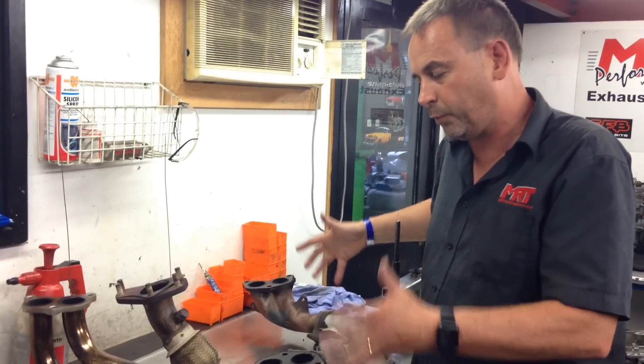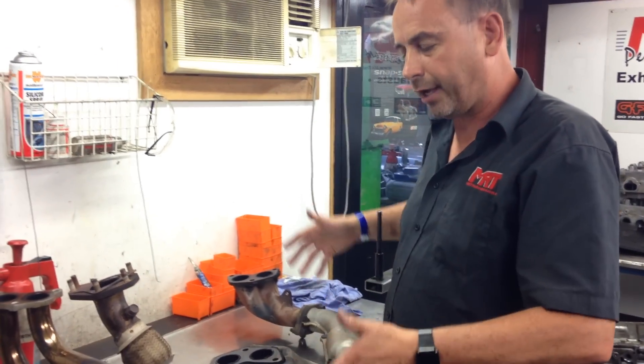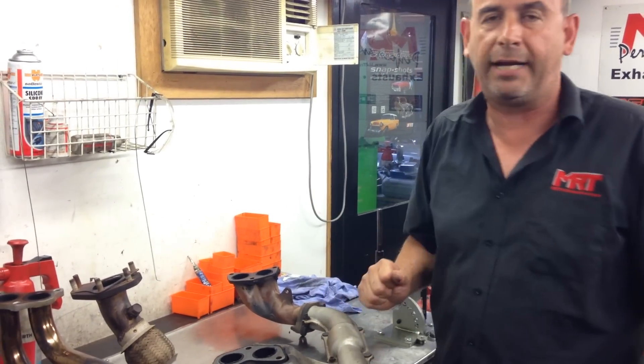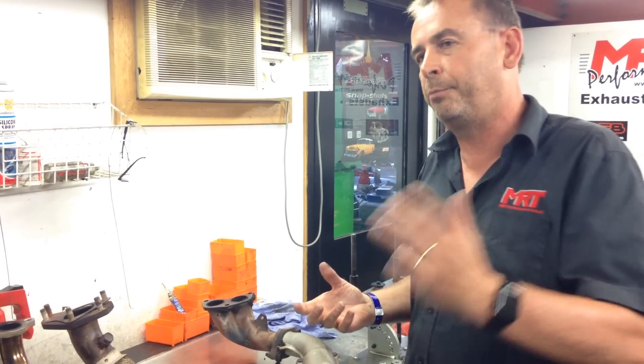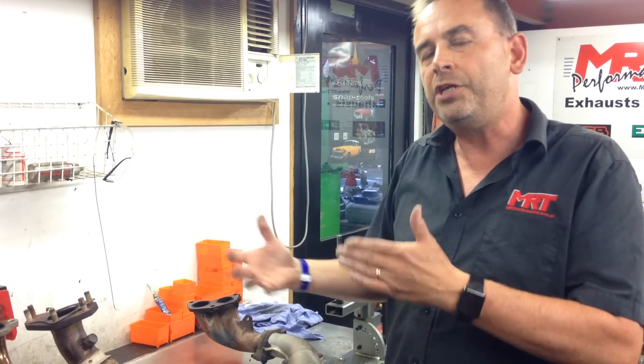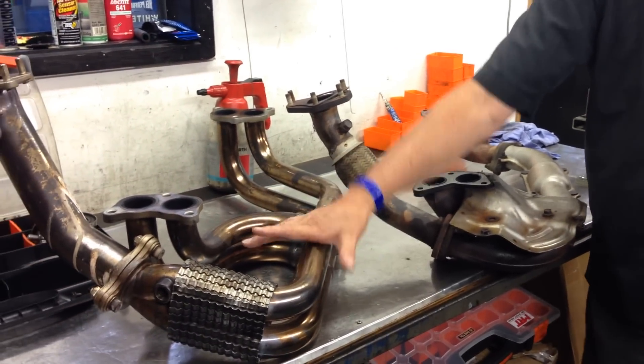Forward of the turbo, I encourage you to seriously consider sticking with a factory-standard exhaust manifold. They don't crack. They're reliable. The worst you may have is rattly heat shields. If you're doing big engine upgrades — say you've pulled your engine apart, your pistons and rods, and you're going to put a good turbo on it — then you start thinking about replacing them with extractors, because these parts will typically flow better and flow more horsepower than the factory-standard part.